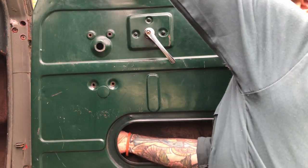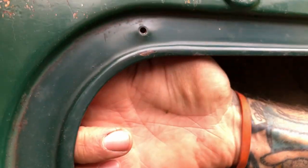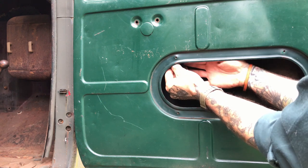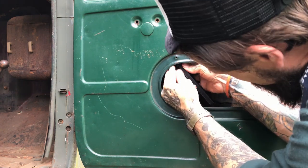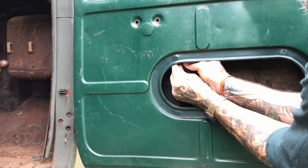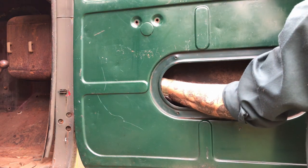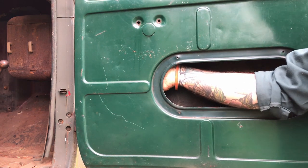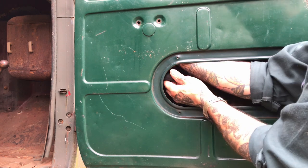I've found where the hole is. I've got my channel going straight and I'm holding on to it with a couple of fingers as a placeholder. I'm going to start by putting the clip on there, push it back in there, and hopefully get close to that hole. It'd be nice to nail it dead on the first time, but you can't just reach in and line up these holes immediately. This job is all about minute adjustments until you get it exactly right — just take your time. This door has been beat in a little bit. It feels like I got it pretty much right the first time after all that talk.